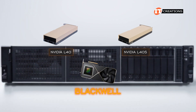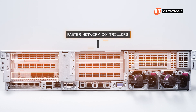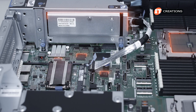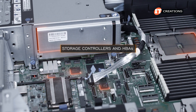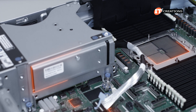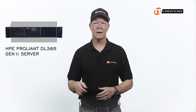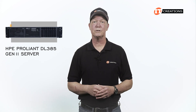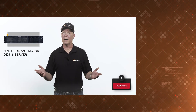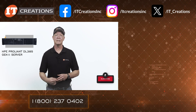Some of the newer Blackwell GPUs can likely also be installed in this system, though HPE hasn't tested them yet. Those PCI slots can also be used for faster network controllers, with InfiniBand options up to 200Gbps. A number of different storage controllers and HBAs can also be installed — it all depends on what you need for your workload. Cores aren't everything, and neither are GPUs if you don't need them. I hope you enjoyed this overview of the HPE ProLiant DL385 Gen11 server. If you have any comments or questions, post them below.